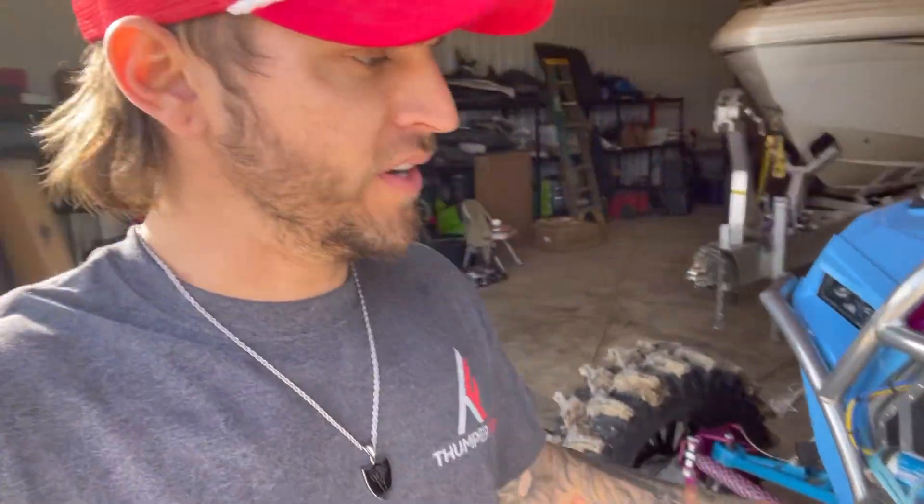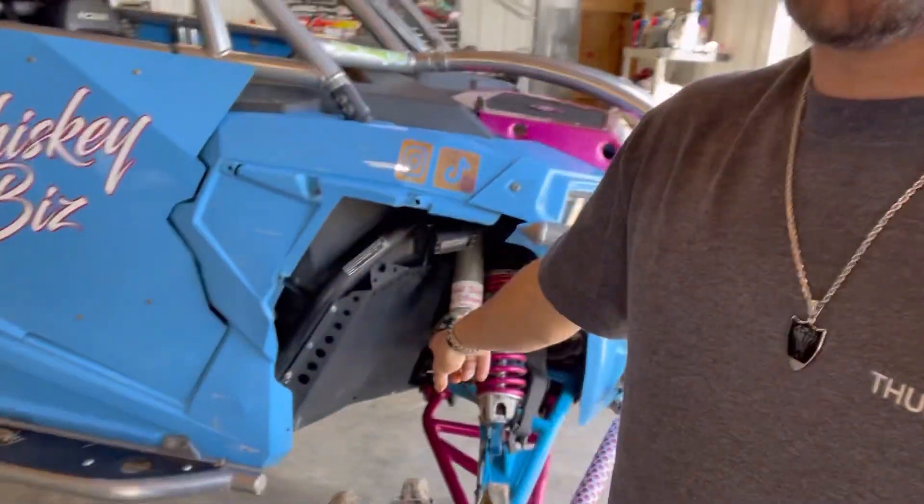You're probably asking yourself, why doesn't this kit exist? Why isn't this something you can just buy off the shelf? Why don't other companies make this? There are way too many different A-arms, tie rods, and different models of machines. Ideally, the ram would actually be where the factory steering rack is — I ended up putting mine on the outside because it was just way easier. The reason this doesn't exist on the shelf is there are just too many options with A-arms, portals, portal plates, tie rods — it would take way too long to do all that R&D. Not to mention it's very expensive. Even though I did this kit myself, I'm still probably $3,000 into it. As far as I know, there's only one person that actually makes a kit, and he's like $6,000 or $7,000 if I remember right. I tried to buy one from him — it just never worked out. Long wait and lots of stuff. Not bashing the guy — I'm just saying I did try.